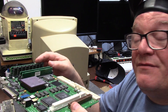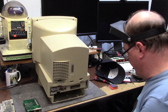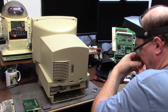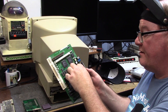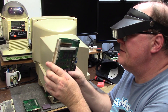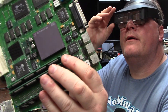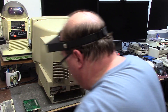Please note your orientation of your CPU where the pins are. So with the chip wording straight up, pull this out, grab our full 68040. Make sure your pins are straight, line her up - I got it. Push this down. Hope I got it and didn't butcher a pin. There we go - full 68040 with FPU and MMU built in.